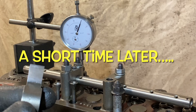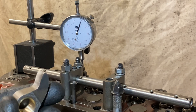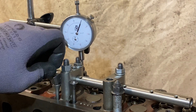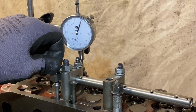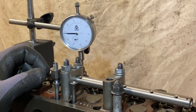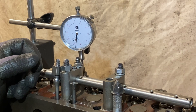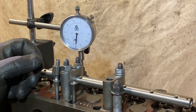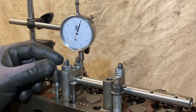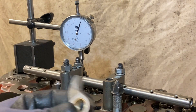So that's it re-faced. You can see that the wear is all gone and there's still a curve on the tip. Let's see what it gives. That says 353, so it hasn't actually moved. So now what we need to do is, having re-faced it, focus on increasing the lift a little bit more.